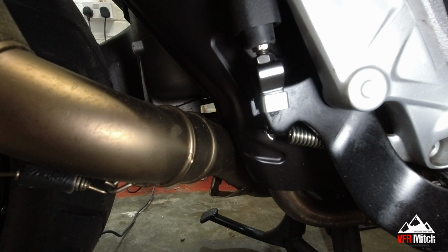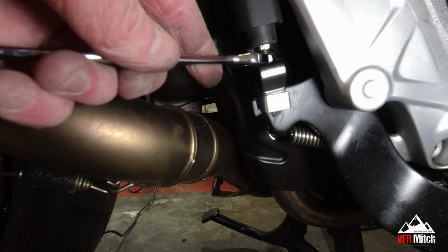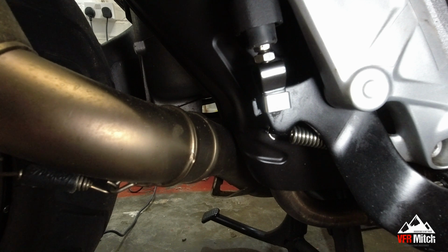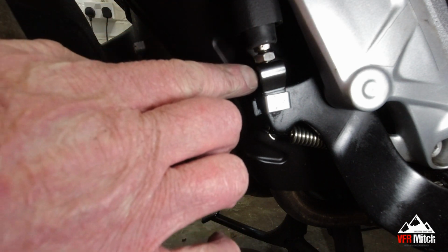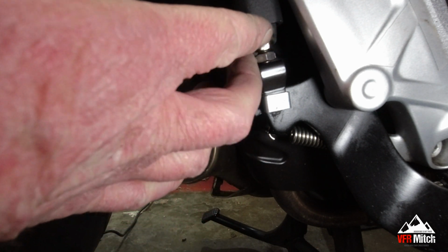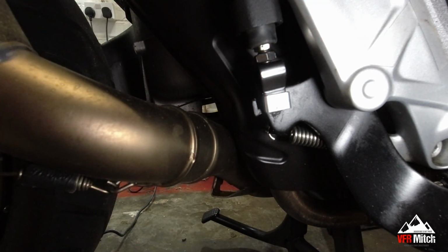I've had a sit on the bike and I do need to adjust my brake lever. So how you do that is, that's 12mm, so you slacken that off, already done it. And then there's a little nut above it which is 11mm. Just wind that down a bit so you're reducing the amount of visible thread between those two heads there. So I have wound mine down a little bit. I'm just going to wind it a touch more. Found it easy with pliers.